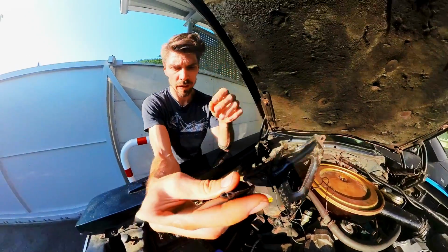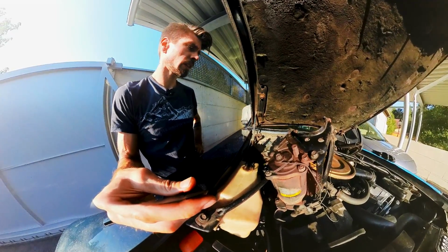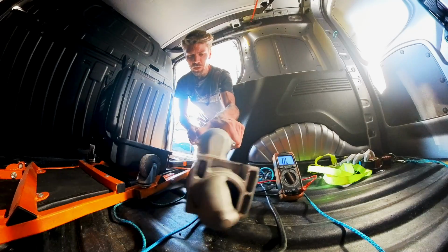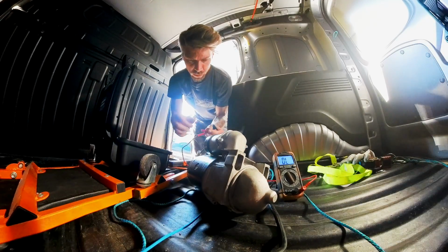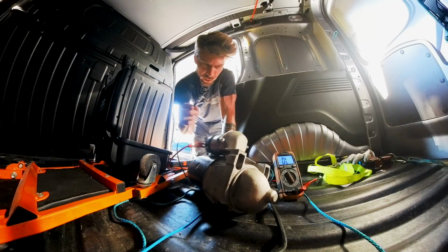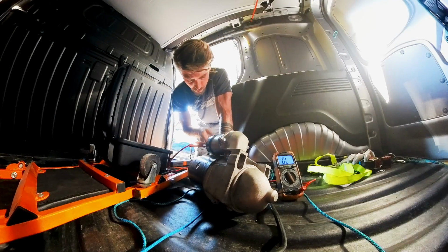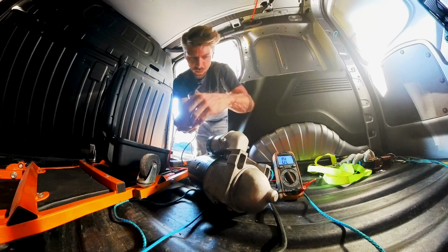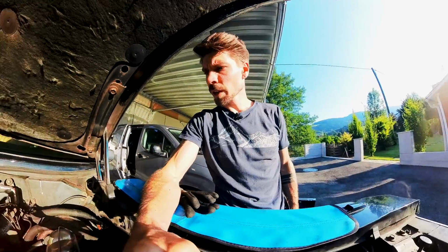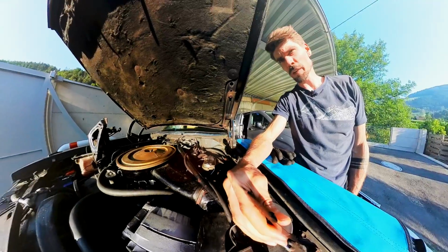I feel like I've tested everything that comes to my mind, everything that could be the culprit, but I can't find it. I even tested this remanufactured starter and wanted to know if that is okay when I hit the S terminal here, which is the purple wire, or the brown one. That's the purple one. This grounds out when the car is not started. So I guess this is okay. And the other connection where the thick battery cable runs to doesn't ground out. But still, I can't figure out what's causing the voltage, the battery drain.